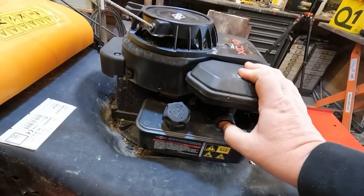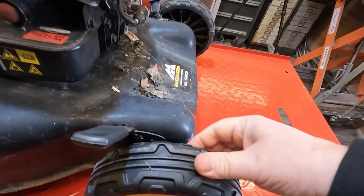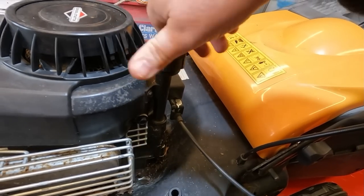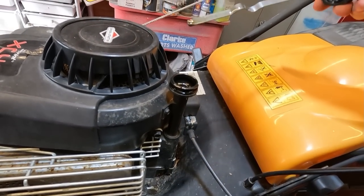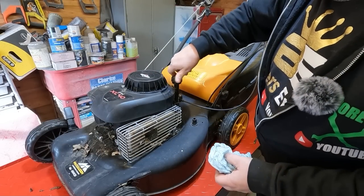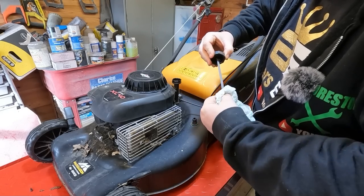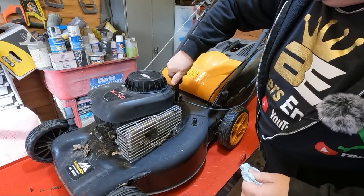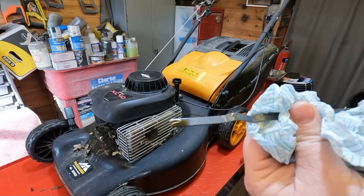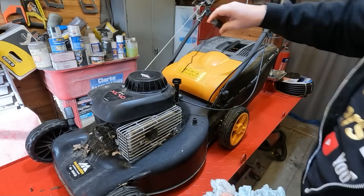It's not priming - there might not be any fuel in it. The handles all seem to be there, the adjuster's looking good, and it looks like there's plenty of tread on the tyres. Let's take the engine oil out and see if we've got any oil in it and what state it's in. I have to wipe that down - it looks like it might be overfilled, but actually it's bang on the money and it looks pretty clean oil as well. So that's a good sign. Let's put that back in.